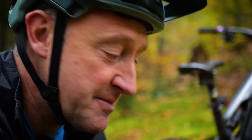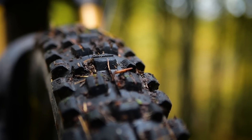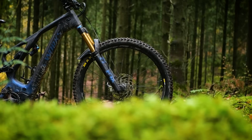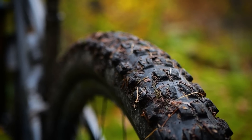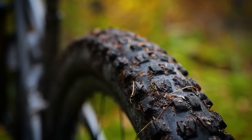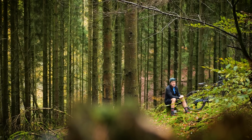You might actually be worrying about the weight of these components, but I don't think there's any need to on an e-mountain bike. The tires and wheels will play a part in this story as well. A lightweight tire will weigh in about 800 grams, whereas a heavy duty, heavy sidewall tire is about 1.3 kilos — so there's an 800 gram difference just in wheels and tires alone.